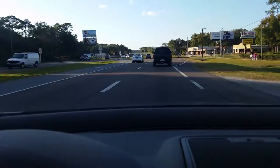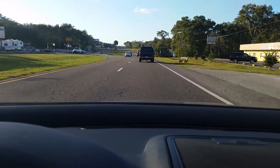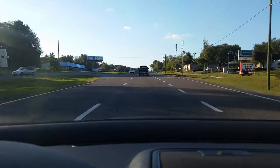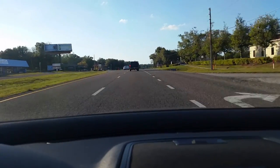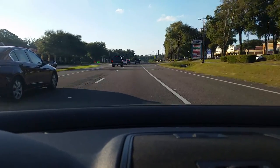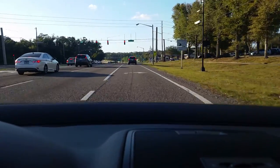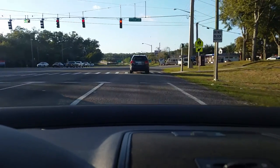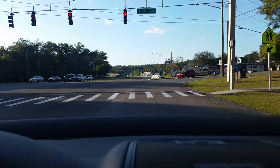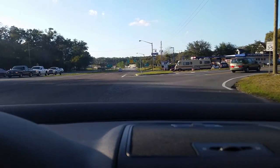I also got a cam follower. That's the one weakness with my engine — that little cam follower. It looks like an old lady's thimble from yesteryear. But that little thimble gets wearing out, and since I'm stage two plus, I probably wear out about every 15,000 miles. So I changed it — it was only about 12,000 but I changed it anyway because we were in there doing a lot of stuff. So I got a new cam follower, a new timing belt, a new water pump, a new tensioner pulley, and a new accessory belt. The GTI has electronic steering so you don't have any belt for that.